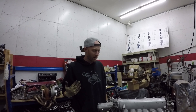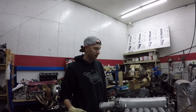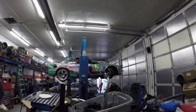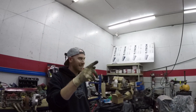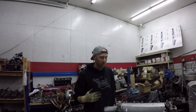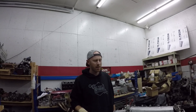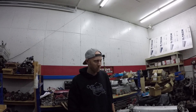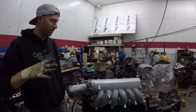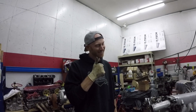I'm not going to go much further today — I've got a lot of other work to do. I just wanted to make this short video of putting this together and checking it out, because eventually we are going to get to putting DC-1 together. This engine is going to be in that thing and it's going to be sick — more powerful than it ever was in Formula Drift. I've got a GTW 38-something-80, some big turbo that's supposed to be good for 900 horsepower. So: 11-to-1 pistons, big turbo, no rod knock, no piston-to-head contact, copper sprayed head gasket, big power numbers.